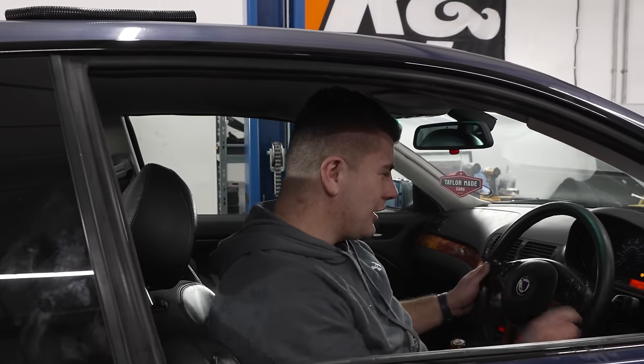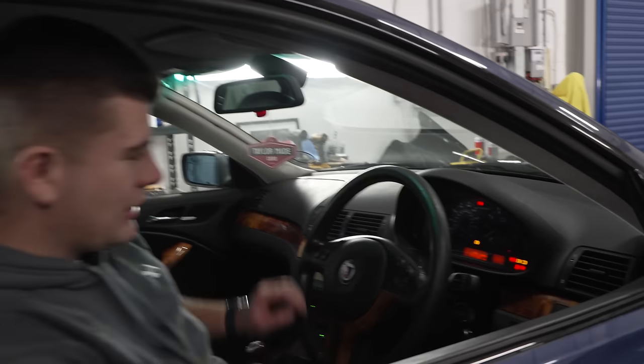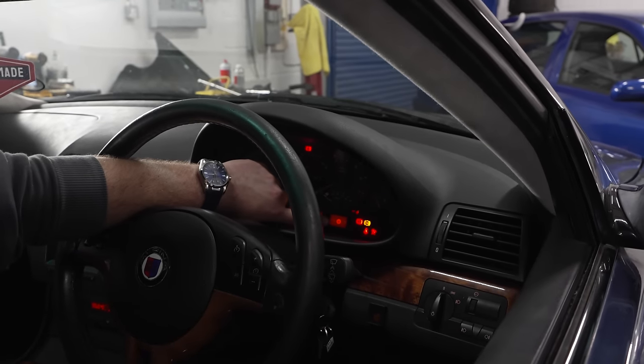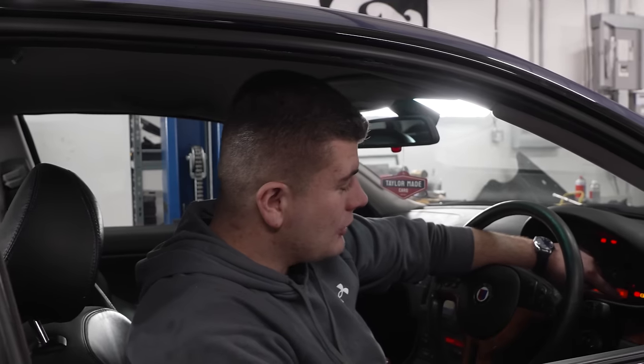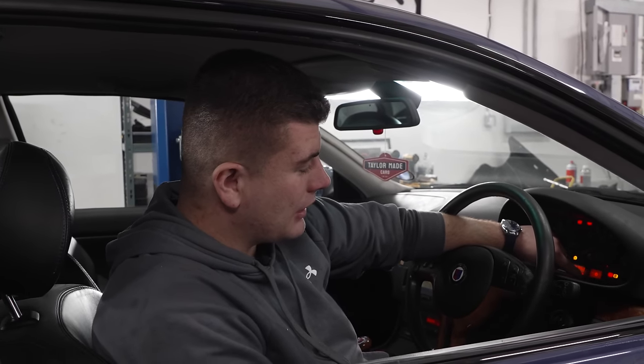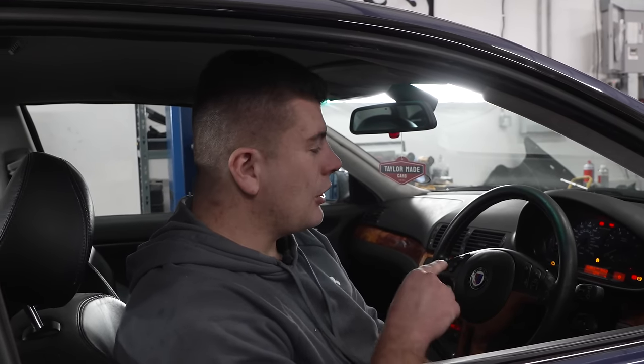And the only one other thing I need to do is, as you will notice, when I put the ignition on, we've got the warning light here to say that the transmission is faulty, which is what I had before. Now, I've got one of these at home. I forgot to bring it with me today, but you get a little blanking plate that goes in there and just covers up that little screen, and that is a factory BMW thing. Well, if you code it out, it will no longer be illuminated, but every dial from a manual car will have a little blanking plate in there, yes.